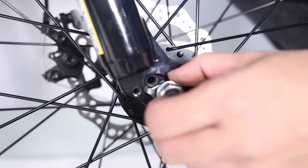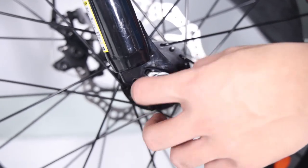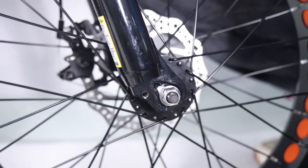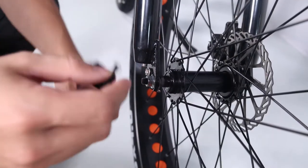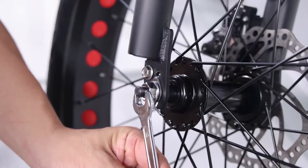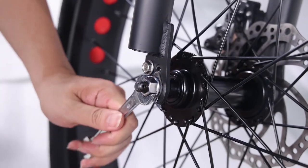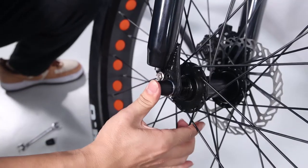After inserting the front axle onto the fork, line up the axle lock washers — the metal washers with a bent tab on one side — with the hole at each fork. These two special fork lock washers keep the wheel from falling off if the axle nuts loosen. Tighten axle nuts by hand once the lock washers are in place, then tighten both with the supplied double open-end wrench. Before final tightening, make sure the wheel is square and true with the forks. Push the black plastic nut caps onto the axle nuts.